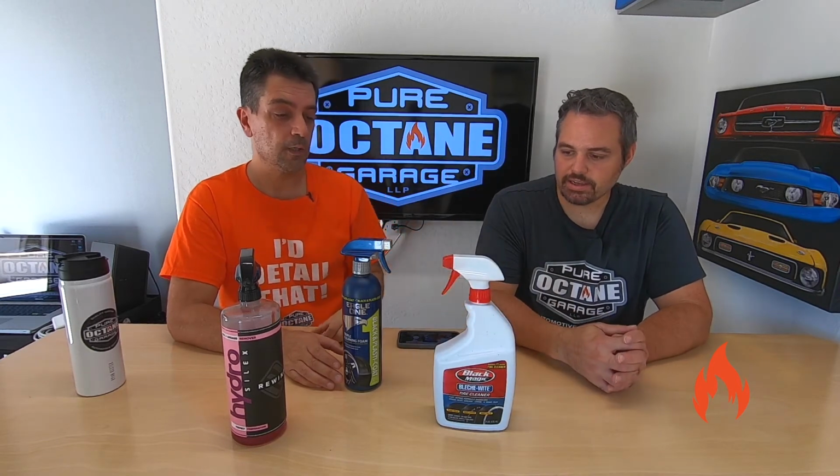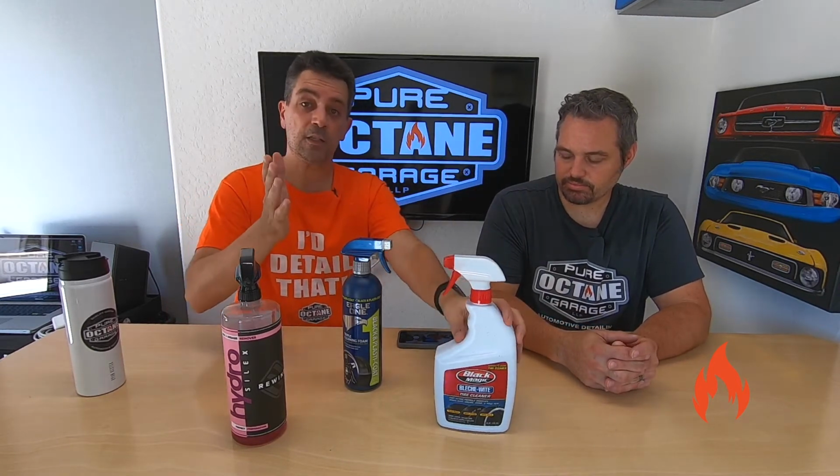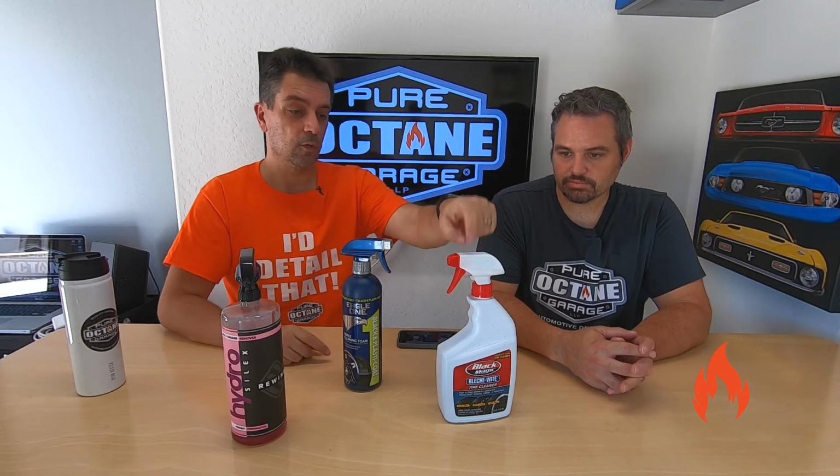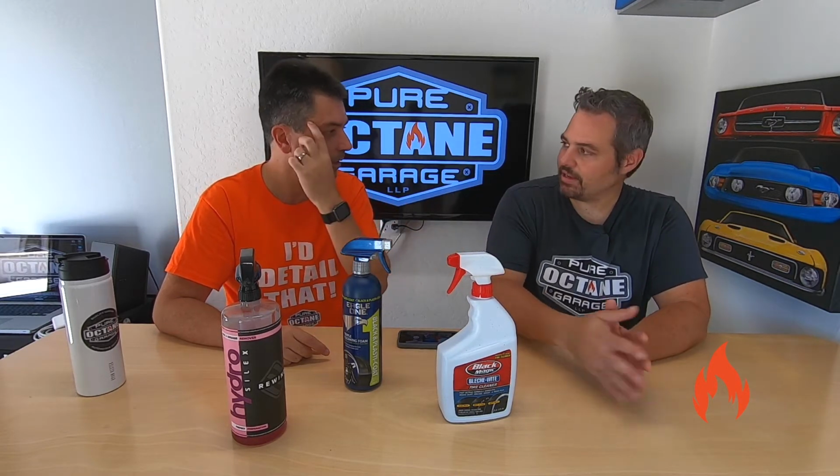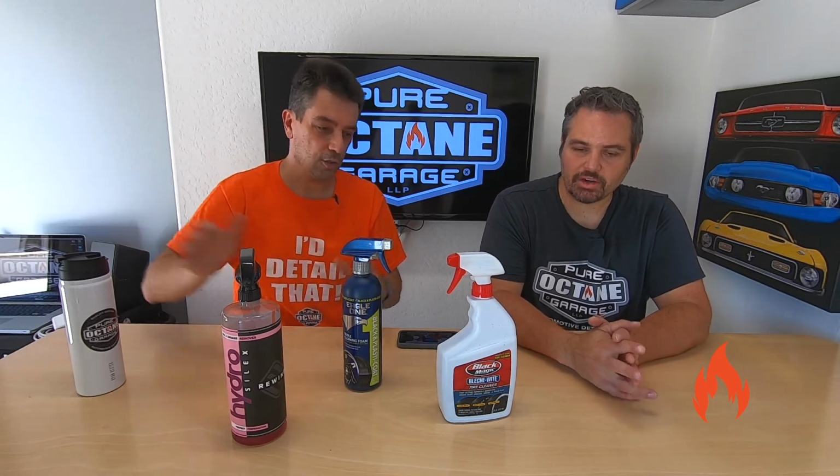We're going to show you guys this in action. So again, for our test hoods, we wash, we coat it down with this, let it sit for maybe 30 seconds, kind of wash around with it, and then spray it off. Dry the panel and then do a final alcohol wipe. And then it's usually ready to go.